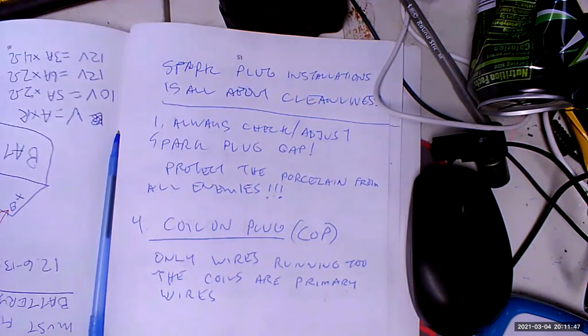Yeah, you're right, because an injector costs $60, $80. Replacing 7 of those for no good reason is well over $500, just for parts. The reason I bring this up: if a shift solenoid goes bad in an automatic transmission, you're not going to replace all the solenoids. Now, if you're a professional rebuilder, you probably would, because the warranty is huge.